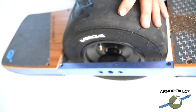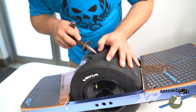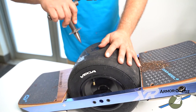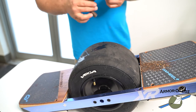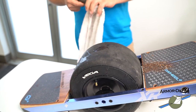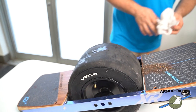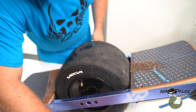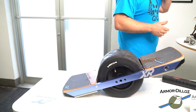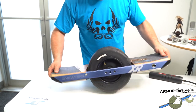So we've got, literally, I think you can see where I chewed rubber out, just grinding it in there. Now, one of the things is the way I'm doing this, I'm actually removing rubber by grinding it. Chances are that's not gonna happen in a regular puncture. So this is making our life even harder because I'm actually removing material. Makes it more likely this is gonna fail. Now, again, just prep everybody up. I expect this to fail, but we're gonna push it to the limit and see if maybe something just really stupid like 3/4 inch could be done.